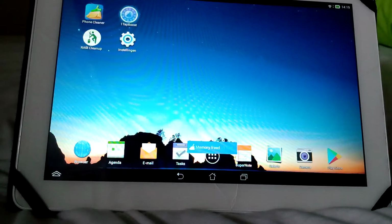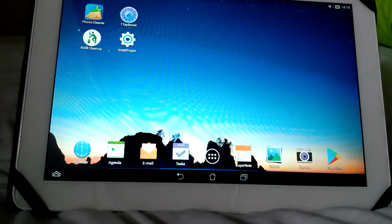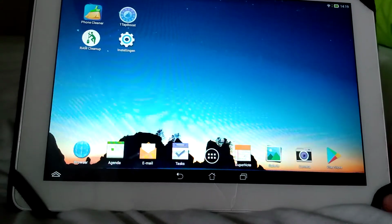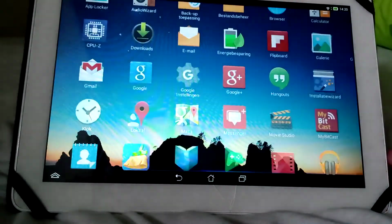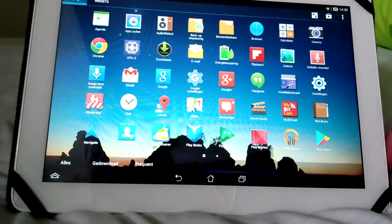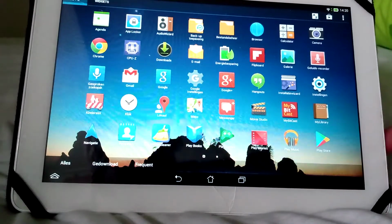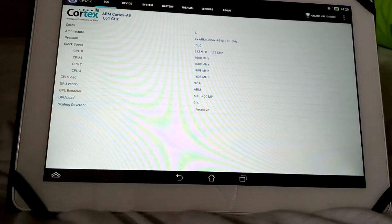The screen resolution is not that happy with my camera. Actually, the screen looks very great in my opinion. I mean, if it's a TFT, then it kind of sucks, because having a big TFT display also means the filter in the screen is going to be big, which means the colors are not gonna be as bright and nice. Do you want to know why AMOLED screens look so pleasant? They don't have a filter at all.